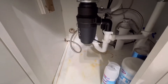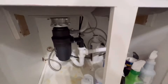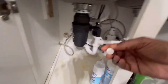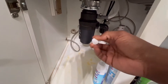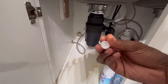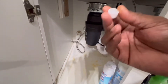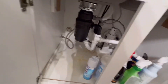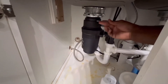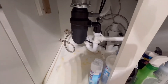— this is the drain right here for the garbage disposal. This cap right here was inside there. When I put it in, I thought there was like a little net to catch debris, but this was actually blocking the whole drain. I found the video on YouTube, came in here, took this little punch, pulled this hose off, put the punch in there, and it popped right out — wouldn't even need much force.